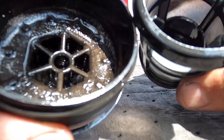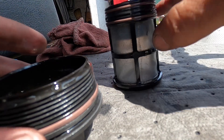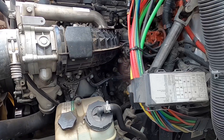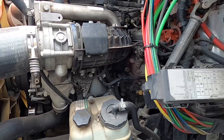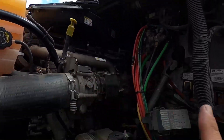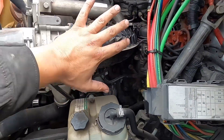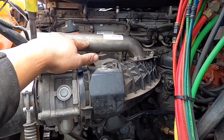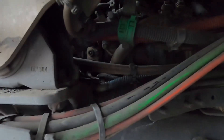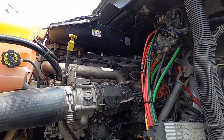So if you see all that glitter, it's time to get a new pump. You're going to have to flush out the system — there's a lot that goes with it. Now what I recommend is get all this stuff out of the way — whatever makes your life a little bit easier, especially with this one because of the way it's tucked in. Get the intake arm out of the way, the connecting hot pipe, whatever makes it easier to dive in there. Whether you come in from the top, the side, or this direction, it's not going to be fun. Get all this out of the way and make your life easier.